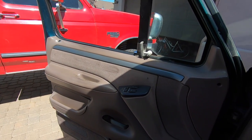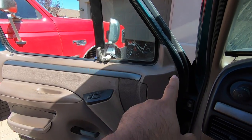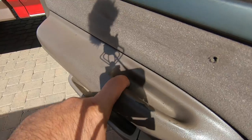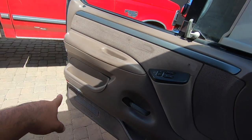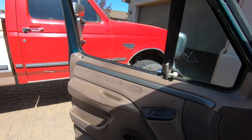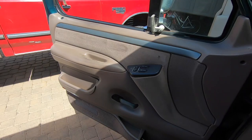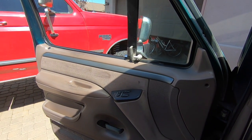It's actually pretty easy to take off these doors. You've got one screw here, one screw there, and then four or five at the bottom of the door, and then a whole bunch of clips on the inside. It's always good if you lock the door because you have to pull it up and out through the handle. It's really not that big of a deal — I'm going to go ahead and get this thing removed.